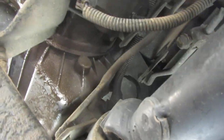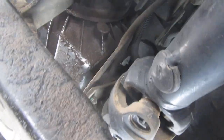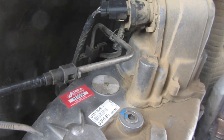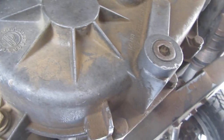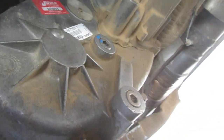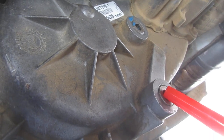From all that off-roading at different angles, I'm thinking it boiled out a little bit, because there's really no air to go in and out of a transfer case. Anyway, the fix was to go to your transfer case, drain it out — I got a little bit more than a quart out.